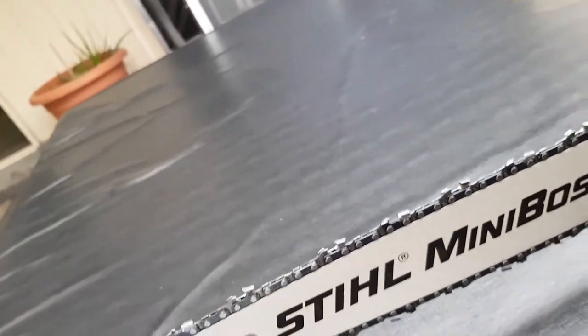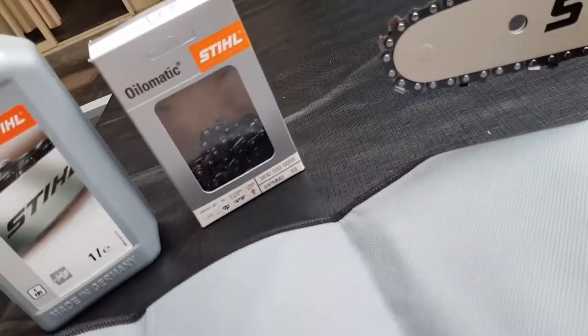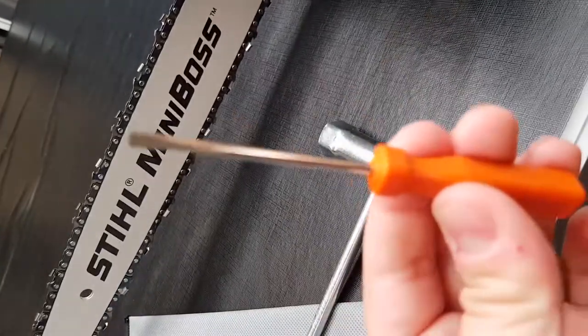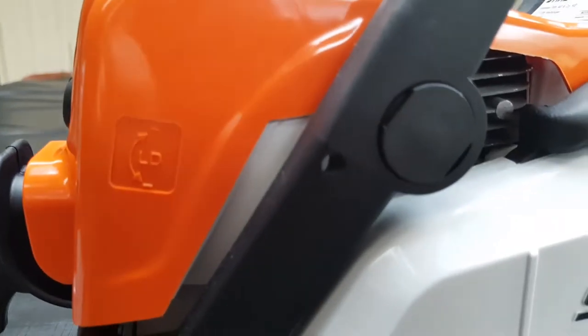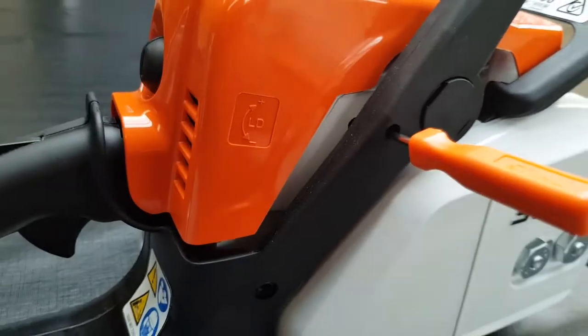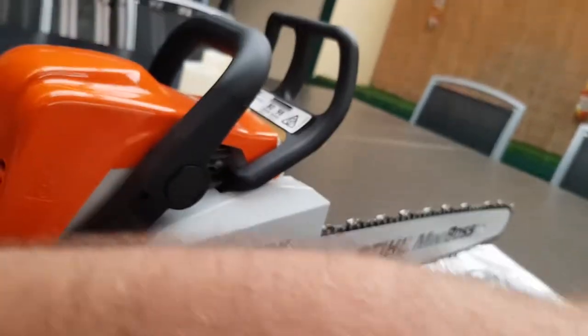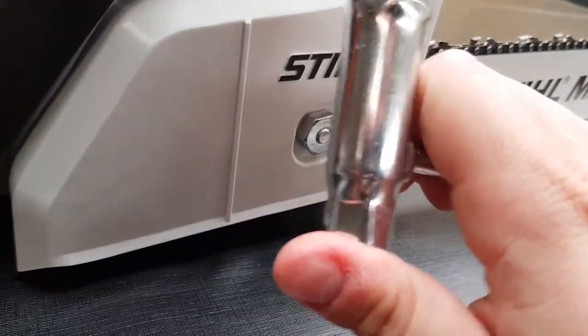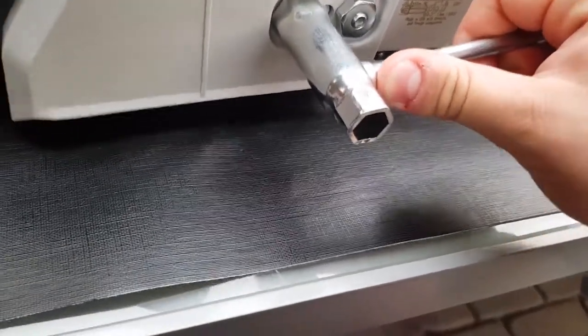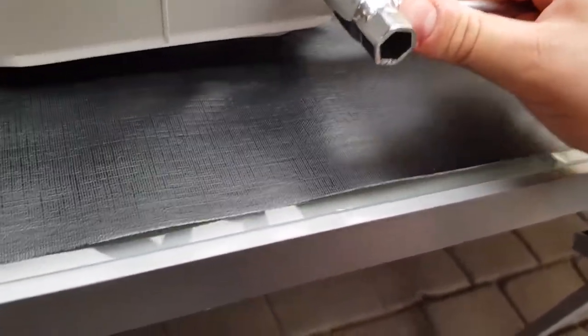It has your tools in here to adjust your chain idle and your idle speed. So you have these wrenches here that everyone gets when they get a chainsaw. You also have this little screw - find out where the holes are. Under here, this is for your idle, so you would put this through here and adjust the idle speed. And you would use this wrench here for the spark plug and the bolts here - so you can check if it's tightened. It's fairly tightened.